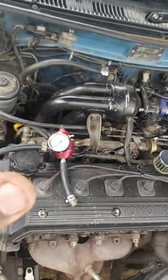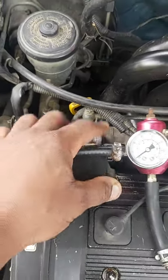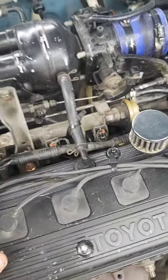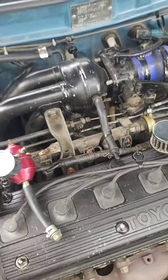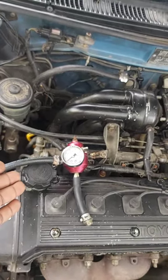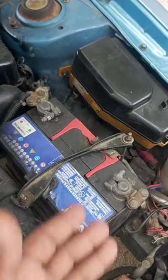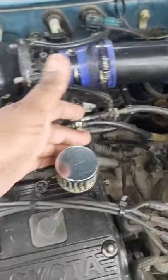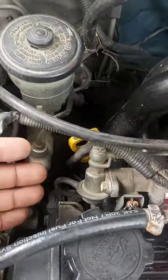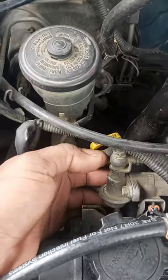Before you start, since I haven't started the car yet, when I go to remove the regulator and return line, some fuel will come out because the fuel pump, fuel lines, and the whole fuel system are primed. So if you want to do this, it's best to do it after you finish driving and let it cool off. You can either pull the fuel pump fuse, or just put a rag down here to catch it. There's not a huge amount of fuel that'll come out, just a little bit, but it's best to put something there to be safe.